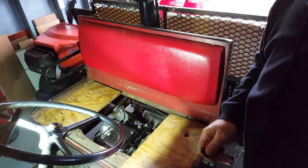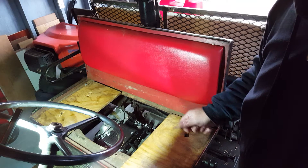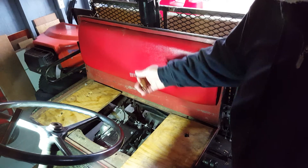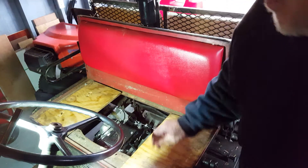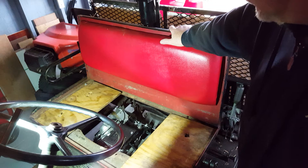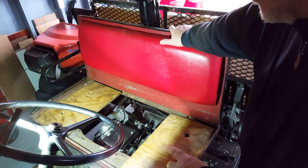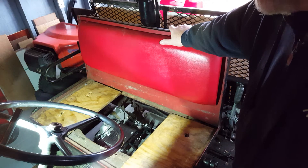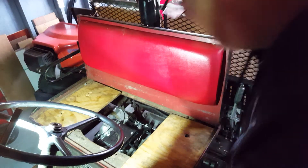Hey guys, here we are back on the Cushman. I made a little modification, we'll see how this goes. This is truly a cold start — not since last weekend. I keep telling you guys I'll get it working, but it's like it's haunted, won't work again. So purely straight off, absolutely cold. No choke — we're on the fuel pump with a modification, a return on it to lessen the pressure against the carburetor. Maybe that was the problem. We'll try it without the choke first and I'll show you what I've done. Watch it — fire on one... okay, fuel pump.